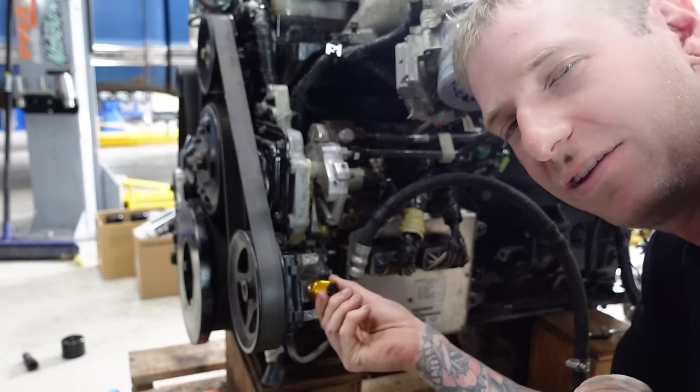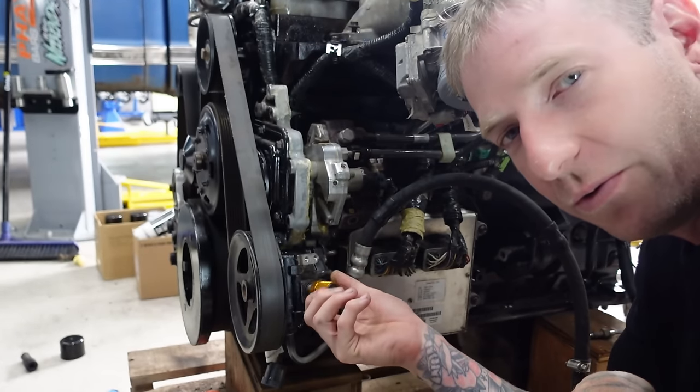Because when the drill and tap set comes out, it's normally a really, really bad time. There are charts on Google that'll tell you the correct drill size to tap size. Don't just go, oh yeah, 16 mil drill hole, 16 mil tap, it's completely different. So that's another tip for you guys.